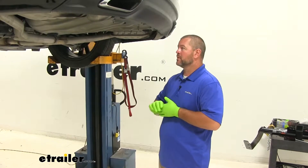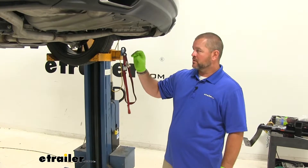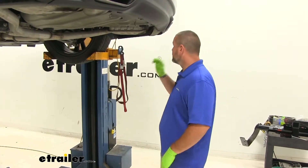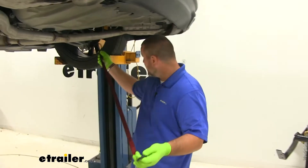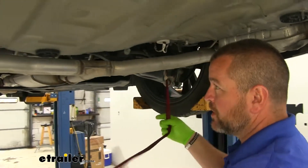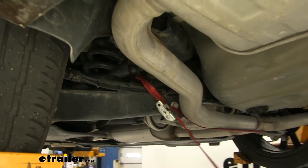To begin our installation, note that your instructions are going to be for a Dodge Challenger, which is a little bit different — on the Challenger they tell you to take the bolts off and remove the exhaust. So what we're going to do is first take a strap and hang it from anywhere that's solid. I like to usually go from the springs. We're going to go underneath our exhaust and tighten it up like that.